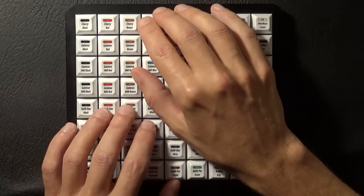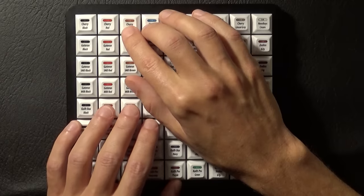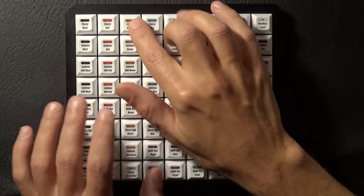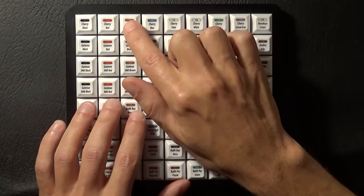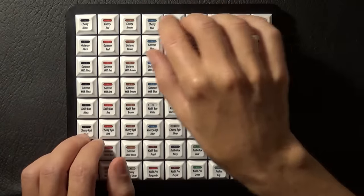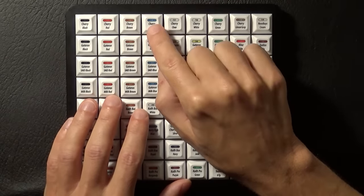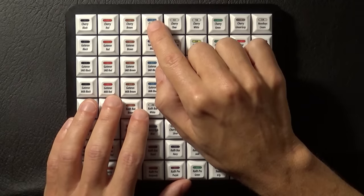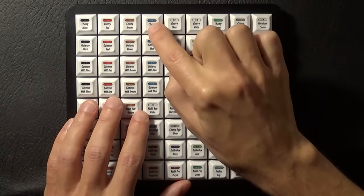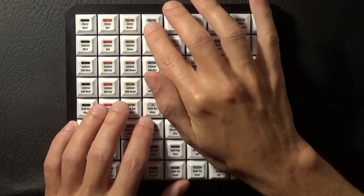And then you can also measure the actuation point, and that's measured in millimeters. It's the pre-travel distance before the key, the switch, actuates. And the standard is 2.0 millimeters. So most of them have 2.0 millimeters. But this one, the Cherry Blue, the clicky one, has 2.2 millimeters. So it will travel a bit more before it actuates. So you can say it has a high actuation point.